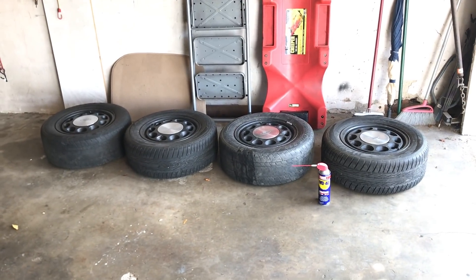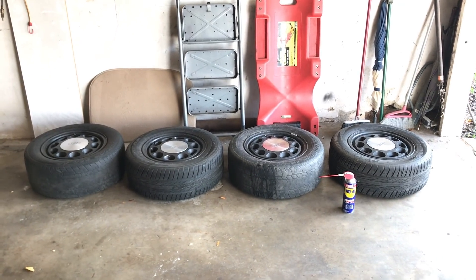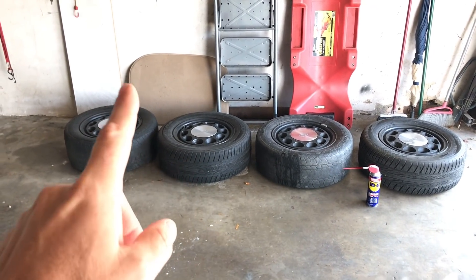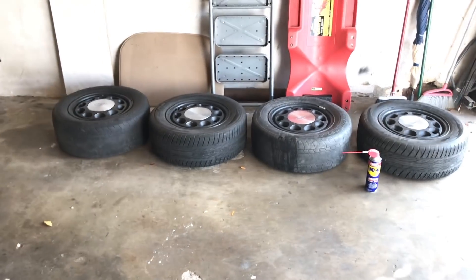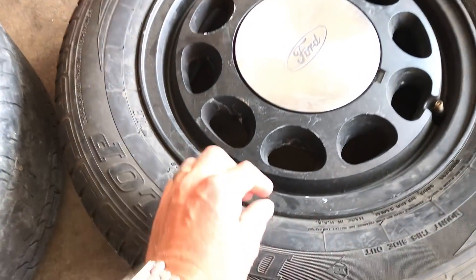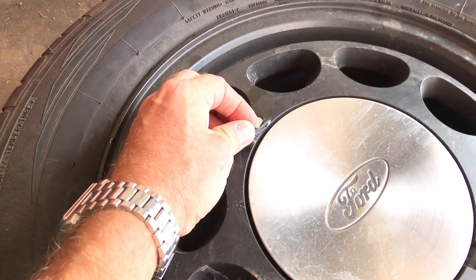One car that inspired me had 15-inch, 7-by-15 10-hole Mustang wheels, so I ended up picking these up for $80. The sizes are 195/60/15 and 205/55/15, which have a similar rolling radius. The goal is ideally 205/55/15 for the fronts, but I wouldn't mind doing a bit of a tire stretch with 195/60/15s. These are Plasti-dipped in the style of the CHP SSP and Fox Body police cars from the 80s — black outer — but the Plasti-Dip is really, really thin.